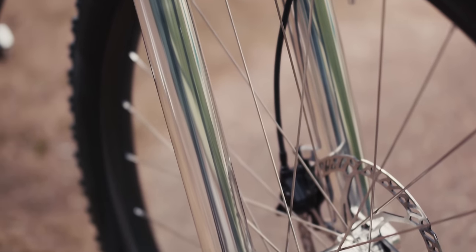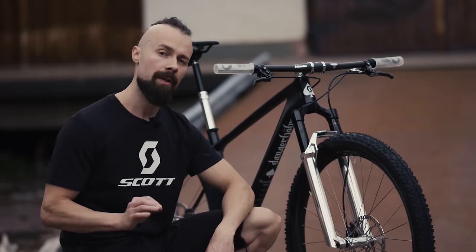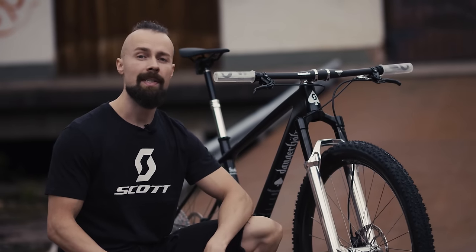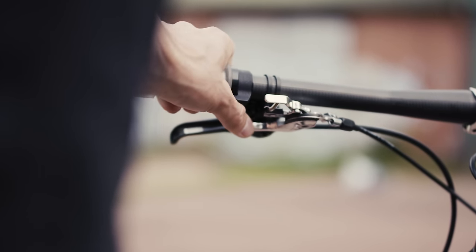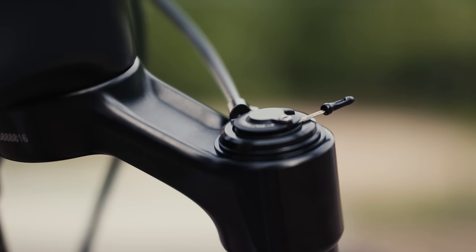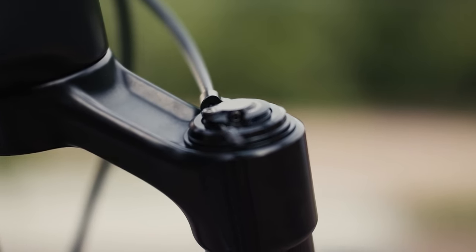It's paired with a RockShox SID Ultimate up front with a 35mm chassis. I got a hold of this fork in 120mm of travel, but personally I find that a bit too much for this bike. Unfortunately, there were no 100mm air shafts available, so I had to modify the stock one myself. So now it sits at around 104mm of travel. Usually you find a two position cartridge in these forks — open and lockout — but here I'm using the three position version developed for Scott's. Personally, I love the middle mode since it firms up the fork, making it much more responsive while still eating up the bumps.